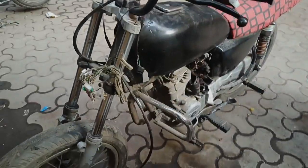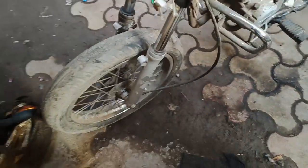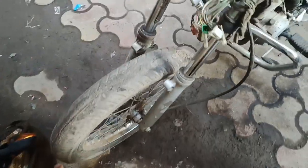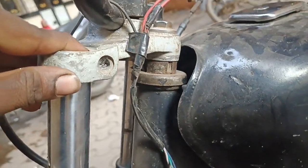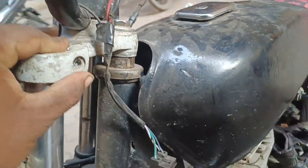As you can see, this is our Bajaj Boxer which we have installed — the Bajaj UG, the disc, the suspension setup, and the disc. So there was a problem. This is the T-plate, it has a hole. We have to replace this T-plate.